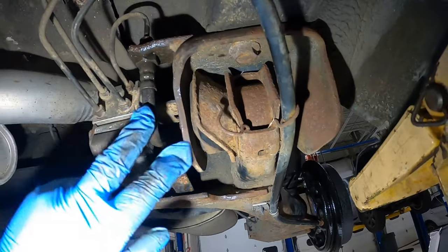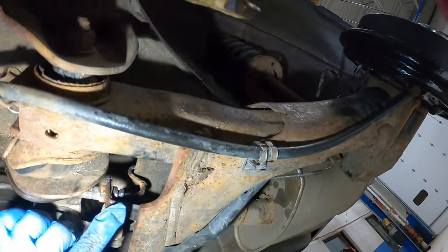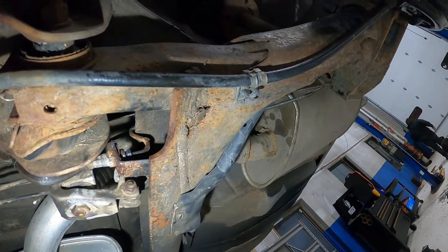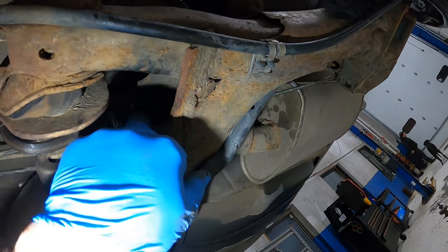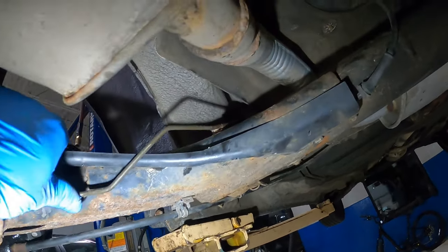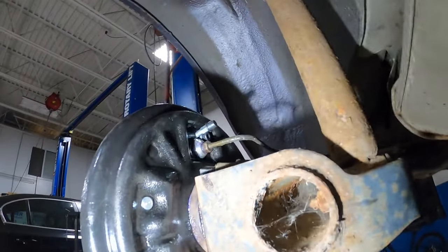This thing, I did not bother replacing the hose. I got one, I was gonna put it in, but not worth it. This brake line here makes a little S in there, and that S is just impossible to put in. You can't get a wrench in there very well, so I ended up putting a wrench on the outside, on the hose side, and then putting another one over here, and I was able to work them both and get them put together. Got the hose up here, that's semi-clipped in. That clip doesn't really work anymore. This clip works, and I got it on the wheel cylinder.